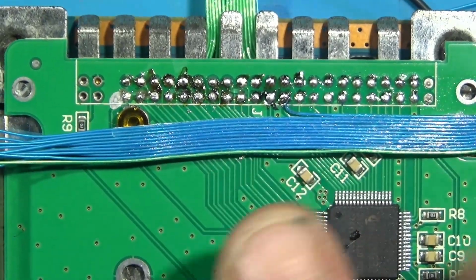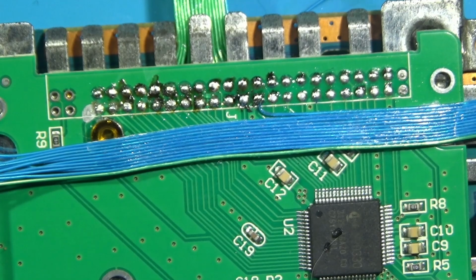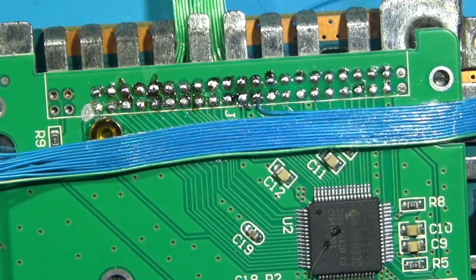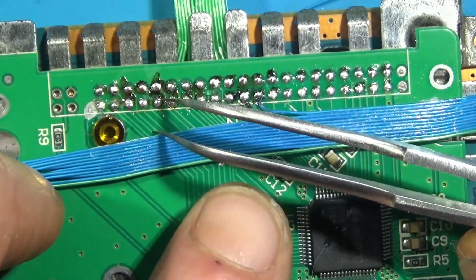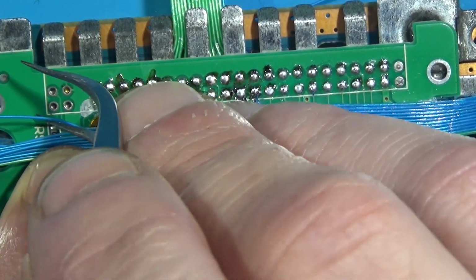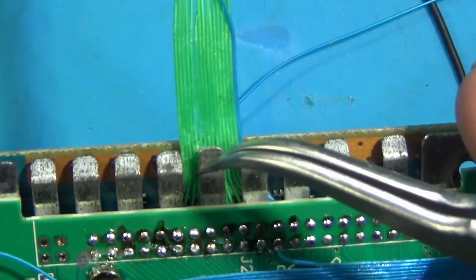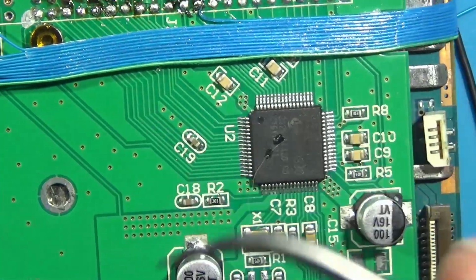Okay, so this is the top side of the board, the IDE pins for the M2 SATA adapter here. I want to do the majority of this off screen, just because it's so tedious, but I want to explain my thought process. So I've already connected this one, it's 23, and the next one in the chain here is 18. That's where photos of the install come in, especially for these ones, as they're under the shielding and I won't be able to just check them when I want. And also a little note here, I use my flush cuts to straighten these ones out just so they don't get crushed. Just a little side trip worth taking there.